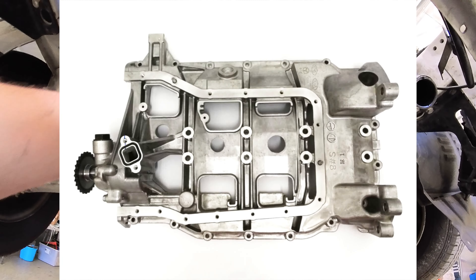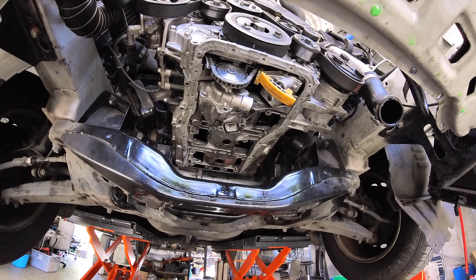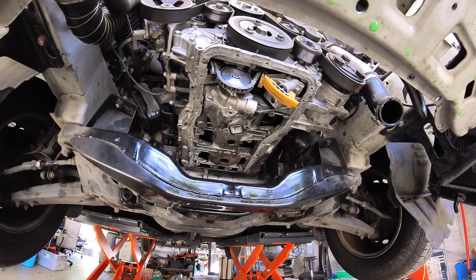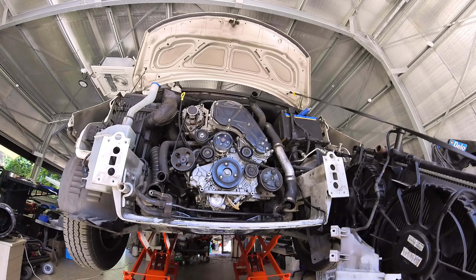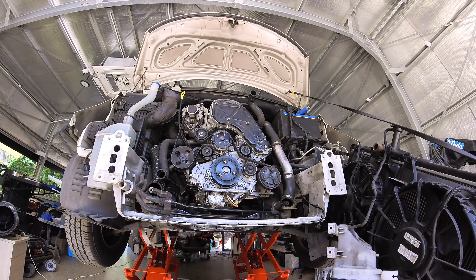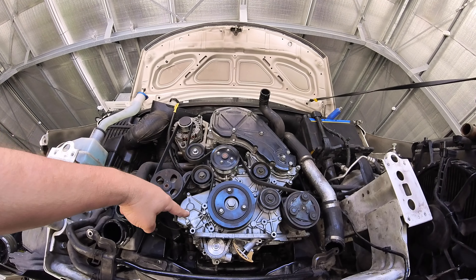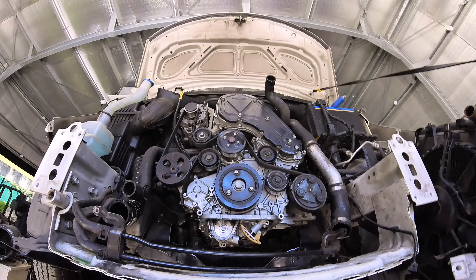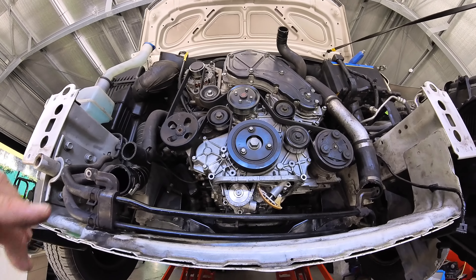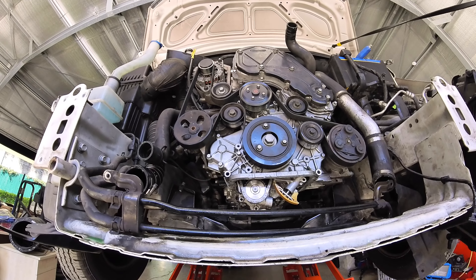Not on this model. On this model, this whole piece is connected with the oil pump. So to get this oil pump out means I have to remove the whole front end, basically everything. Got to remove the top timing chain, all these timing covers. I've got to really go to town on it, all because there's a bolt you can't get to - to take off this bottom tray. So one thing's leading to another.